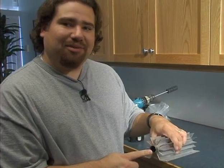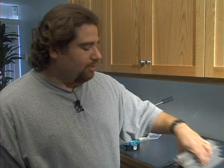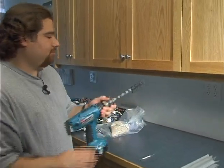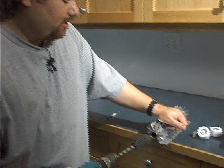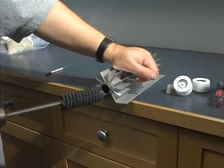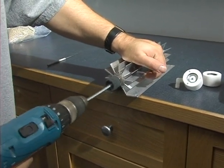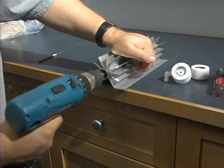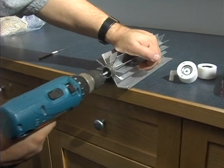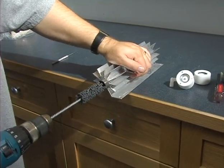If it requires it, the cathode can be honed out. Usually you can just shove an alcohol-soaked rag through to clear out any debris. We're going to go ahead and show you honing it out — we'll typically do this if there's any kind of water damage or if you have the hone handy.